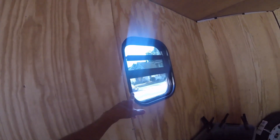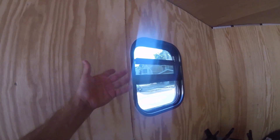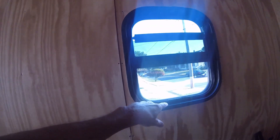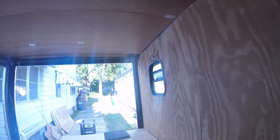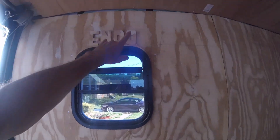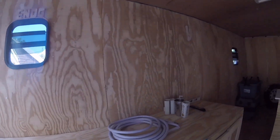The windows I ordered were inch-and-three-quarter, and because I got a great deal on them and couldn't find inch-and-three-eighths, I cut out a little three-eighths inch ring to fit around so I can draw the window tight. It's a clamshell kind of thing where the trim ring screws hold the outside top to the trailer. On this trim ring I also added a little flourish at the top — my dog's name, Endo. My granddaughter noticed it right away and liked it.